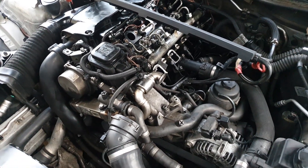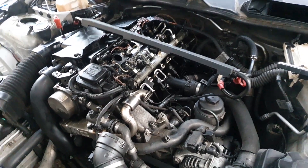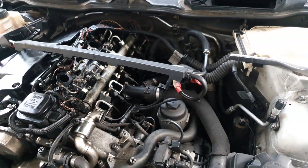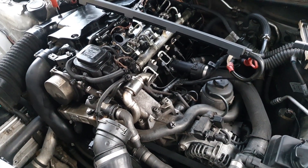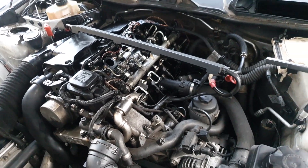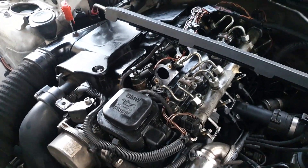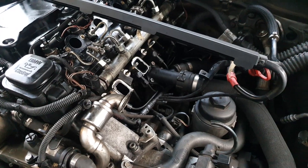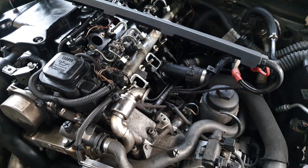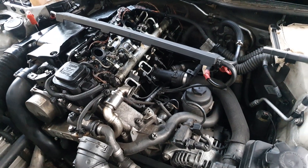Today I've just been met with failures. The injectors I put in didn't make any difference whatsoever, so I'm putting my old ones back. Everything is already plumbed in and connected. I'm going to put the intake back in and further dive into why it's losing fuel pressure or power on the top end. I think it's the timing — it's a bit off somewhere. I'll hire or get the tool and do the timing one of these days and bring you guys along for the journey.